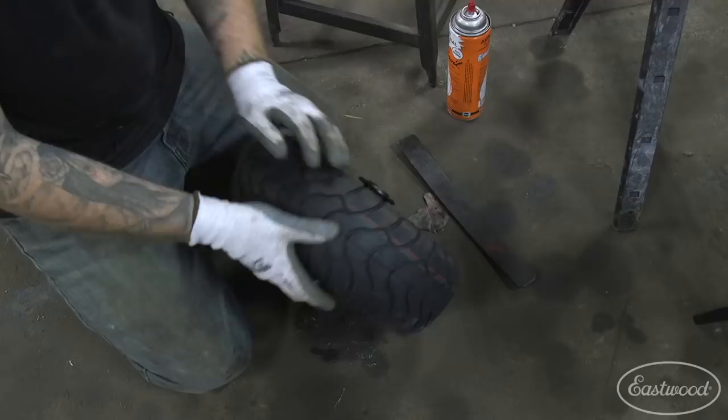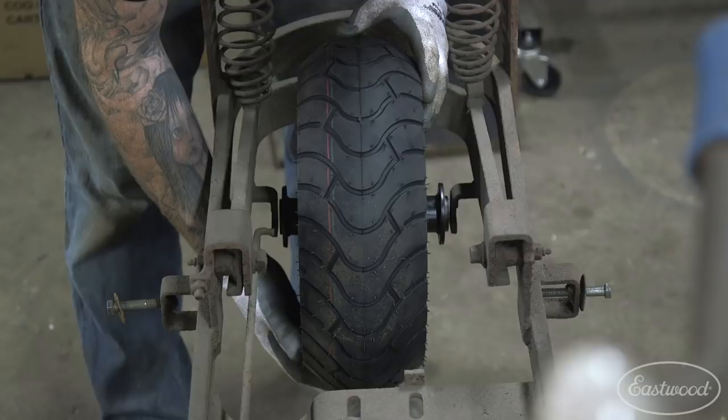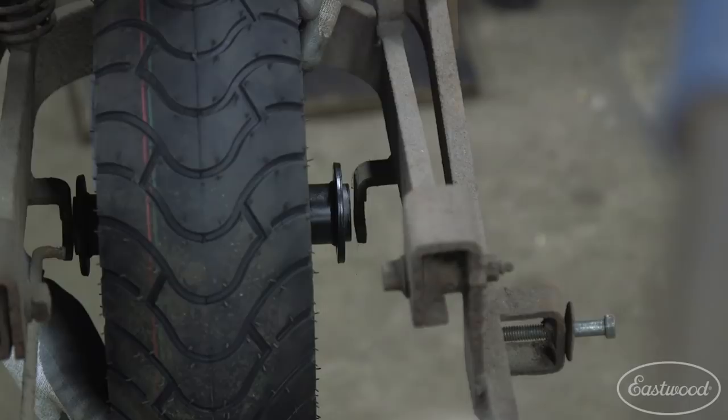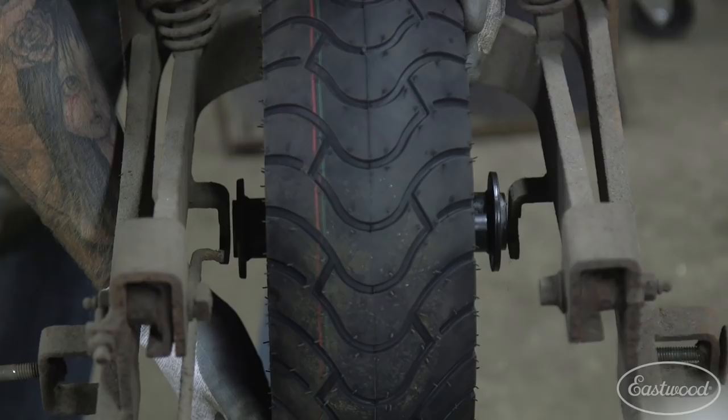All right, so I'm actually quite surprised. I was just shooting from the hip and just ordered this wheel because it allowed me to move the sprocket to either side, and it actually dimensionally fits almost perfect, if not perfect. We can put little spacers on either side of the hub to actually get it to tighten down and fit well, and that also allows us to space it just a tiny bit if we need to get chain alignment a little bit. We could cheat it, but otherwise we can just put two spacers on either side, and this will sit perfect once we put an axle through it.